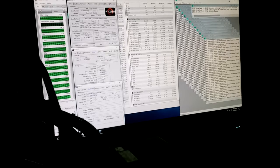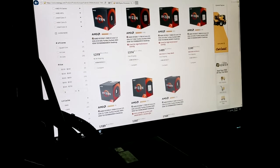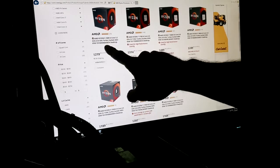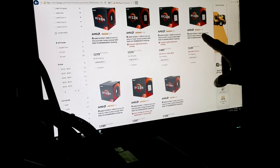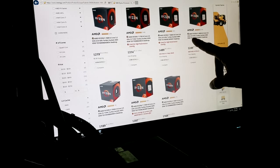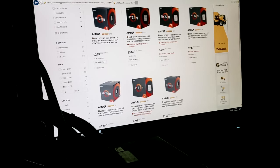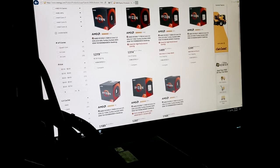Let's go over this real quick. These are the AMD Ryzen chips we're working with: the Ryzen 5 1600x and the Ryzen 5 1600. In the last video we covered that the 1600x has a default clock of 3.6GHz, CPB pushes it to 3.7GHz, and we only got 3.8GHz out of it at 1.3 volts — and to do so we had to sacrifice turbo. So that chip: drop it in, leave it at stock, maybe even undervolt it.